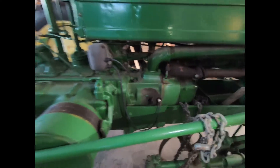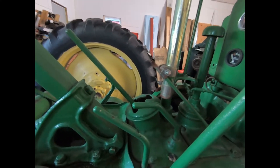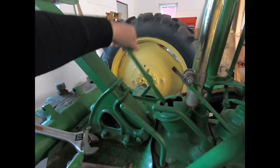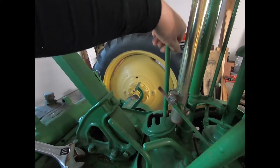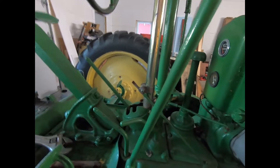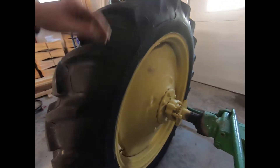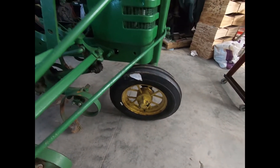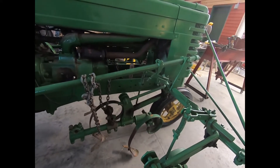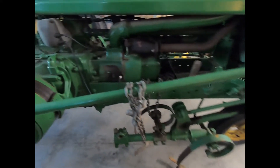So it was made during World War II. And consequently, there's nobody home up here — not even a fork or nothing. So they took fifth and sixth gear out of this because it was on steel when it was from the factory. After the war, they put a regular set of rims onto it, which is kind of handy. You can see the front was on steel also because they've got cutoffs, they've been welded on. That makes it where I get frigged up ordering parts a lot of times — it's got rubber tires, so you order the seals for the rubber-tired stuff, and you should be ordering them for a steel wheel.